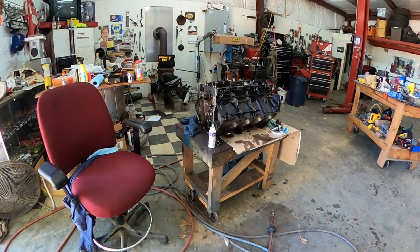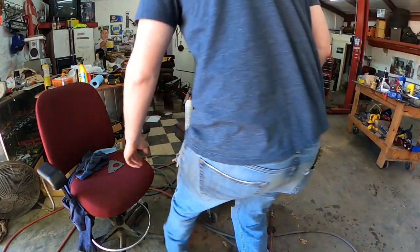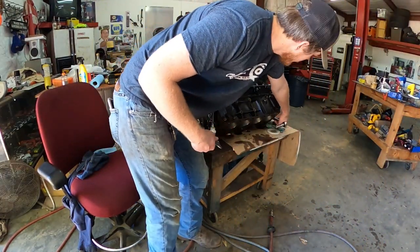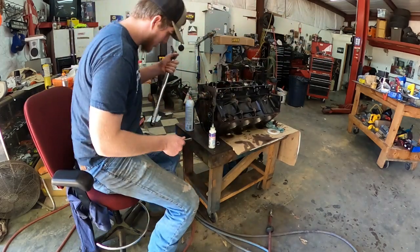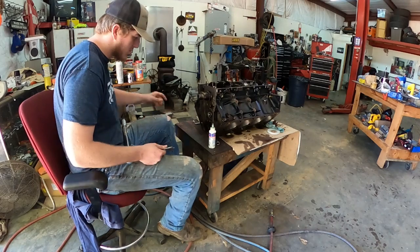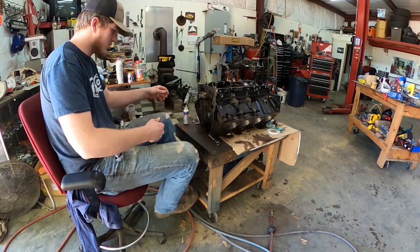They made it right for me, so we're going to put this timing plate cover on. They said to do it, so let me clean off the bolts and then we'll put this on. So, like the rear main seal, these will torque to 18 foot-pounds as well. Again, make sure your mating surface is clean, no oil or nothing like that, for best results.